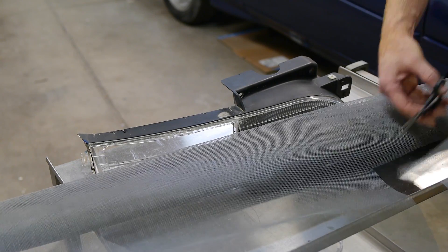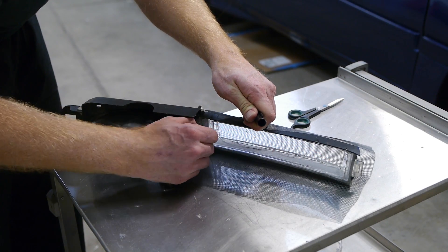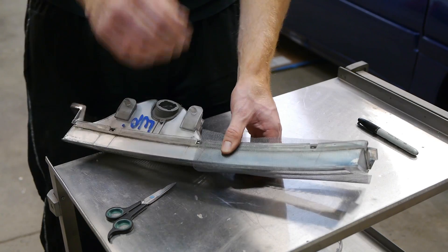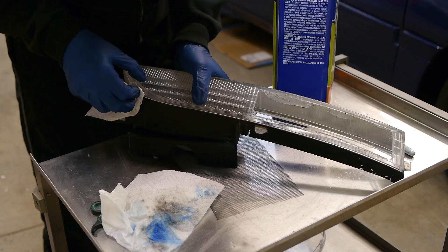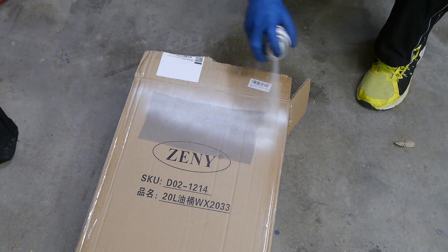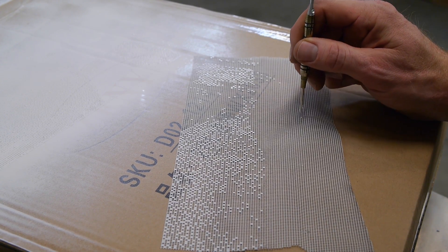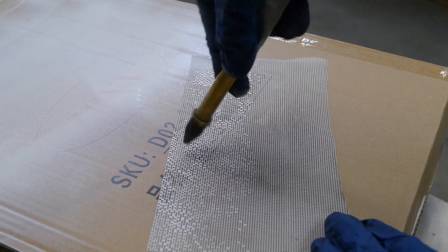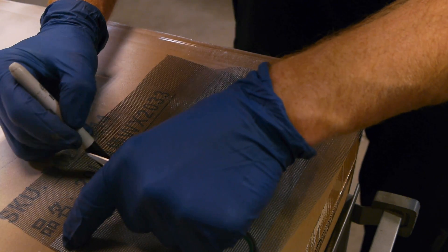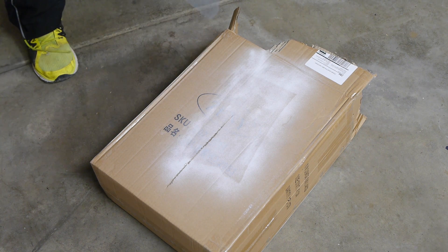It's screen mesh — or just mesh or screen, whatever it is. I have no idea where this came from but I've had it forever. I think it's just screen door stuff from Home Depot. We're gonna cut some out and trim it to fit. I'm gonna leave it overlapping a bit on the edges, but the color really doesn't work for me because it's not helping hide the hole in the lens, so we're gonna paint it white first. Before painting the mesh I used some paint thinner to clean up the headlight and get rid of any grease or residue. Then I laid the mesh down on cardboard and sprayed it down making sure to get both sides. I put it on too thick the first time and it clogged up a whole bunch of the little holes in the screen mesh. I tried saving it by punching out the holes with a dart and even tried blowing it out with compressed air, but it just wasn't saveable. So I cut another pattern and sprayed it better the second time — holding the screen up with my fingers and spraying it that way gave much better coverage without clogging it up.